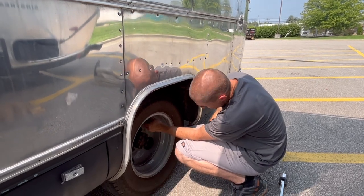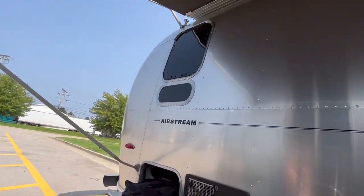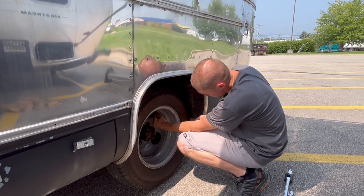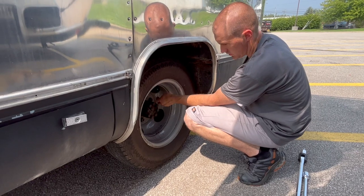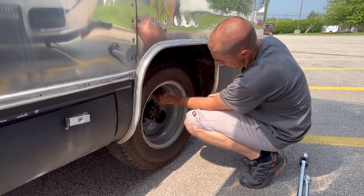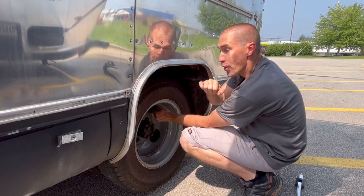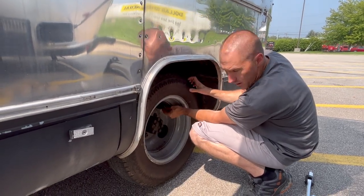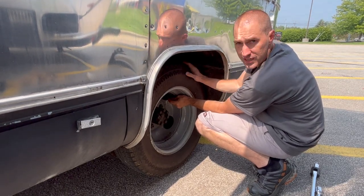You were right about pulling alongside the trailer and opening the awning. The sun's almost directly overhead, so I don't actually have shade right against Dreamboat where I'm working, but I do have the tools out of the sun, which is at least something. Your back is shaded, so it won't be long before we get some more shade. Step one: we're going to air down the outside tire because it doesn't fit past the fender easily, and hopefully the inside tire will hold the weight just sitting here.